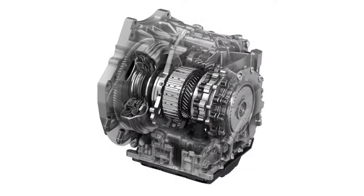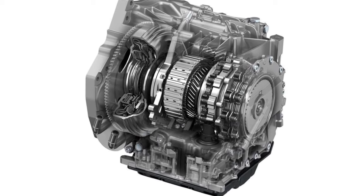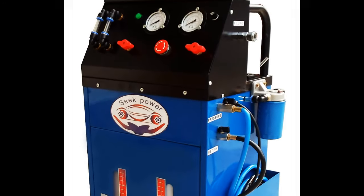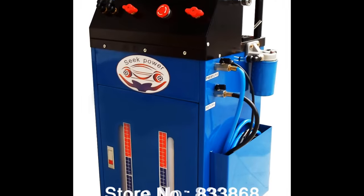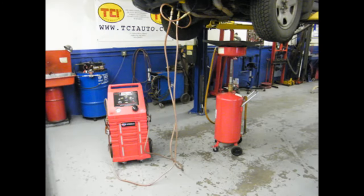As my car is front-wheel drive, the gearbox is even more complicated and compact, but the theory is still the same — it still has the torque converter which retains the fluid. Normally if you're going to do a fluid change service, you'd drop the sump of the gearbox and also change the oil filter, but unfortunately the Volvo doesn't have an easily serviceable oil filter — it's almost like little tea strainers throughout the system, so that isn't viable in this case. Now if you took it to the garage, they're not going to flush the oil three times — they'll connect it up to an oil flush machine and pressurise the gearbox to flush the old fluid out with new fluid. It's a very quick system, but there is a risk called fluid shock that can affect the internals of an older gearbox, so this is not a system that's really recommended for older cars.